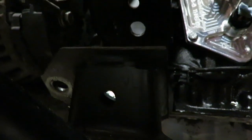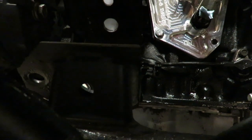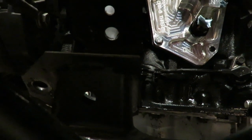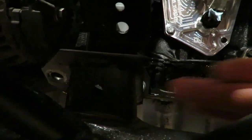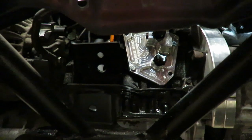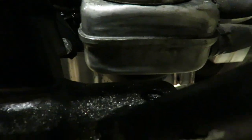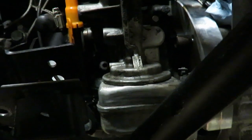That mount is off. I just cut right along next to that weld — I don't really want to cut that weld off. We might have to do something special with that mount to get it to bolt on the side here, but we'll figure that out. So I'm going to put that cooler back in and make sure everything clears just fine, and then we can get to fixing that motor mount. There it is — we got about a half inch of clearance between the mount and about a half inch between that frame, so that should be plenty of clearance.